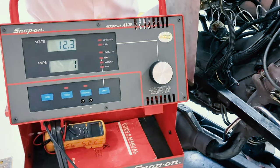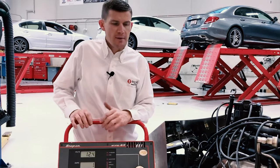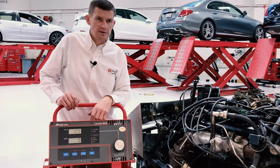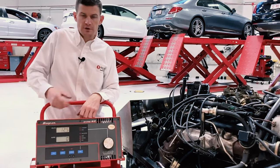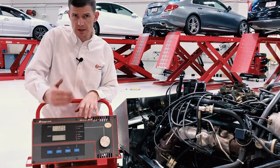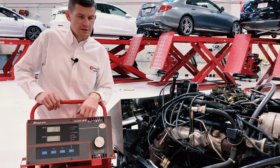So roughly on that crank, we had about 200 amps being pulled — 200 amps going down to our starter motor and through our starter solenoid. What that tells us about this circuit is likely everything's okay. The amperage is slightly higher, but being this is an older V8, there's probably no issue. It seems to be cranking fine, so this would be acceptable. To recap: high amperage with low cranking speed means mechanical resistance — something like a seizing engine. Low amperage means high electrical resistance in the circuit, such as corrosion, loose connection, nicked or cut wires, or a missing ground from an engine or transmission service.